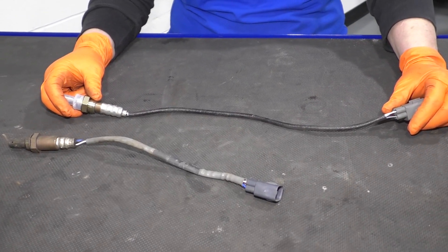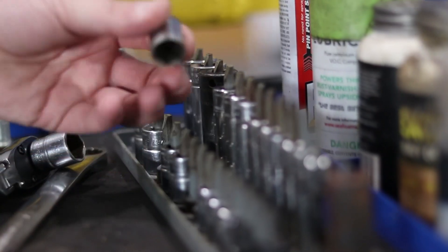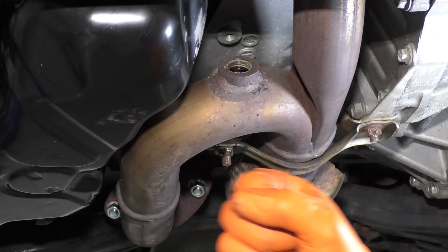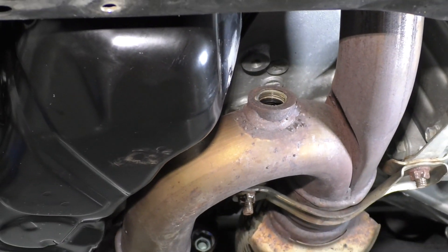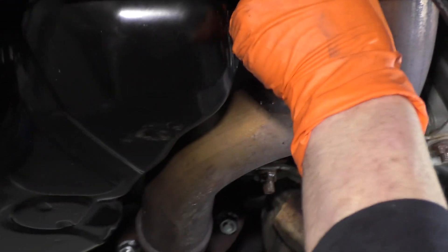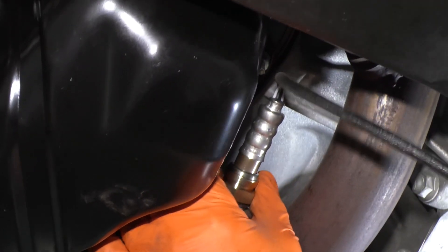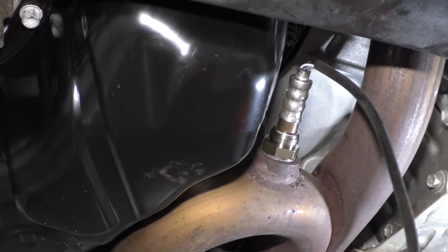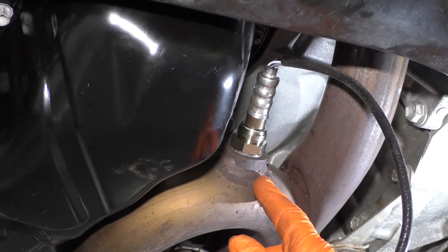If you need this part or any other part for your car, click on the link below and head on over to 1aauto.com. Before I put the new O2 sensor in — I knew it came out pretty smooth — but if yours was rough coming out, take a good look at the threads in the exhaust pipe. Make sure there are still threads there because I've seen them stripped out completely. These look pretty good, and you'll be able to feel it as you start threading the new one — you want to feel the threads grab and fall right into place. If it gets really rough, they do make a tap specifically for oxygen sensors, but hopefully you don't need that. Make sure those threads are cleaned up and that it goes in nice and tight.